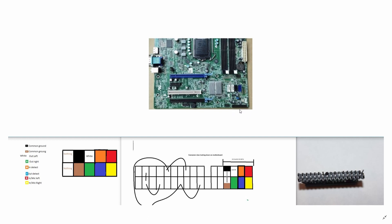Your front I/O cable plug can be modified by cutting off the front panel and splicing the wires on the connector as shown in the diagram, so you can jump the points by splicing the wires together. You can also take the front case audio if you're using the Dell plug and just cut the wires off the HD audio plug and twist them together with the wires on the Dell proprietary plug.